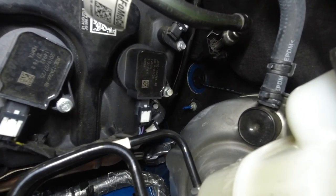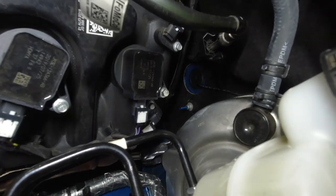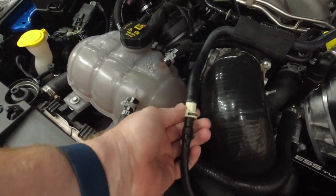That hole is accessible from inside the cabin up under the dash area. I grabbed the vacuum line, attached a small piece of rubber line to it, and that rubber line goes onto the fitting on the P3 boost gauge controller box that I have zip tied up under the dash — you just plug the rubber line onto that little nipple on the side of the box. I like to secure all vacuum lines with a zip tie, especially if they've got boost going through them, since positive pressure makes it important to keep them secure.